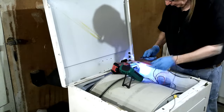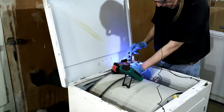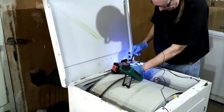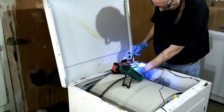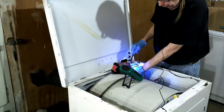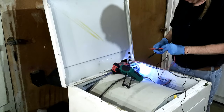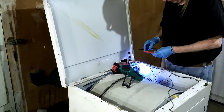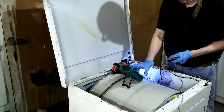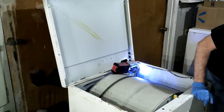I'll just put this on here — I know it's not hooked up. I didn't know if dryers had residual voltage, but you still get 0.14 volts when you touch that. It sits at 0.15, so there must be a little residual something in some capacitor somewhere. But this is all AC, and it's a 220 dryer, so I want to be extra careful. If I look at that right before I start, I know I don't have 220 on it.